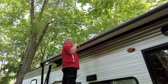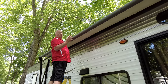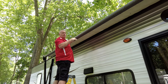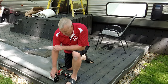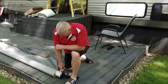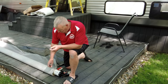Now that all the screws are out, I should be able to just pull this out of the arms. How I'm going to do this is take it off and lay the whole roller up on the roof, then go up on the roof and slide it down and have somebody receive the roller on the ground. Now all that's left to do to get the old one off is take this end cap off, which has three screws, and then there's one screw in the slot where the awning is going to slide into the roller. We'll remove those, unroll this, and then just slide it out.